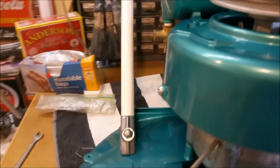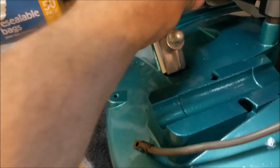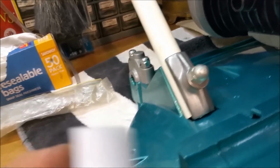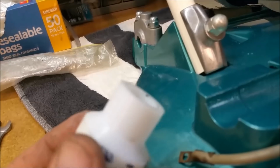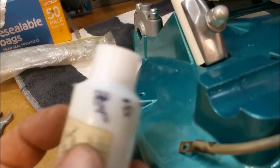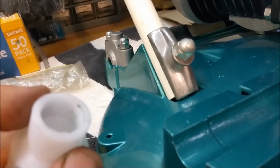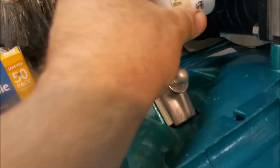I've made this. Well, I haven't finished it, and I did it wrong. It's just a little bit loose over the inlet port and a little bit tight to get into the carburetor. So I'm going to have to make another one, or at least dock that off and just machine it down further. I want it to be a reasonably tight fit over there, the same in the carburetor, and then I want to just run a hacksaw down part way so that when we clamp it, it stays there.